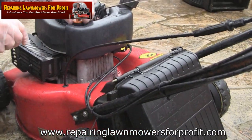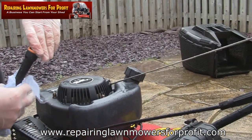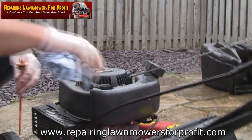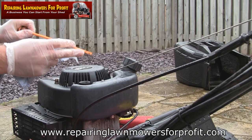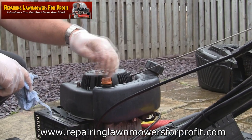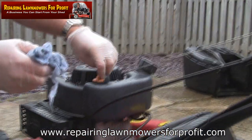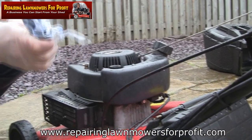I'm just going to check this oil. There's a bit in it. I hate this because the whole thing comes off — the dipstick doesn't actually come out, you end up with the whole thing coming off. You can never — it always sticks every single time, probably because nobody ever goes in it. And really to screw this back on tight you need to take the petrol tank off, which is a bit of a faff. I'll just clean this off here — I need it to be between these two marks. So let's see how much we've got — I'll thread it in just to check. Absolutely next to zero showing on the stick, so that's not a good sign.